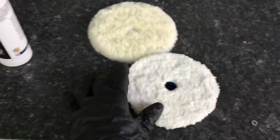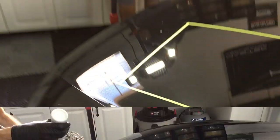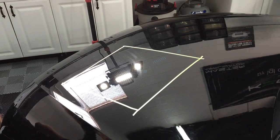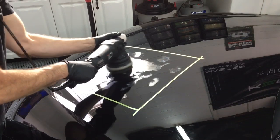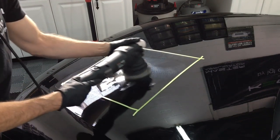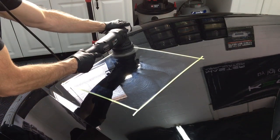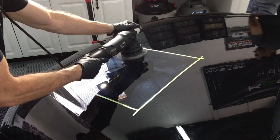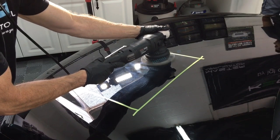Let's switch to the DA and a couple of pads. I grabbed the 50-50 pad, the Euro pad, a microfiber cutting pad which I very rarely use nowadays unless it's a multi-step, and you can also use that low lint wool pad from Lake Country on the long throw as well. I have a test area masked off on the hood this time. We'll start off with the Euro pad, the 50-50 pad — this is one I will always test with first. It's one I prefer; it cuts and polishes at the same time and is very effective, saving a lot of time. The hood, compared to the trunk, has a bit more damage, some more imperfections.